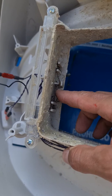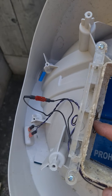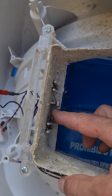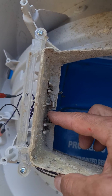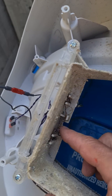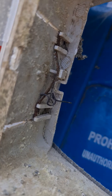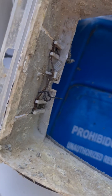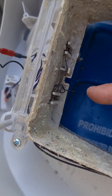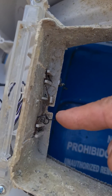This is your sensor. When the two wires are connected — these two plates are connected — it's in a good state. When they're disconnected, it says 'pinch detect' and doesn't work anymore. They're rusty, as you can see. I don't know, with the price of this thing, who makes them of metal that doesn't last even a couple of years. For us it's been less than a couple of years, and this is dry weather here in California.